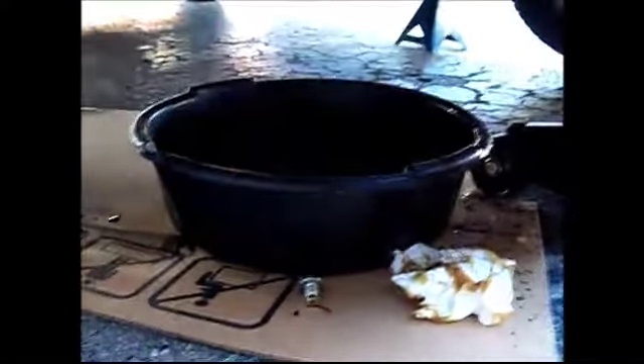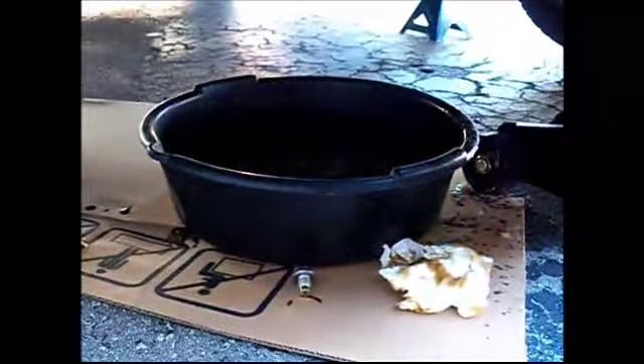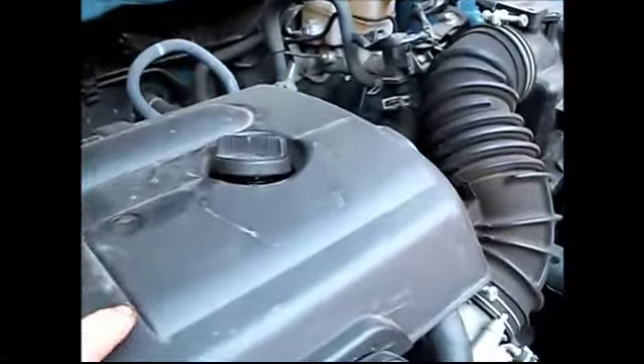So we've left the oil drain now. You can see here the reason why we have the cardboard — if there's any bit of wind, the oil will get flung every which way. And we've loosened the filler cap so that there's no pressure in the engine and all the oil can just drain right through.